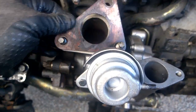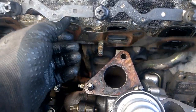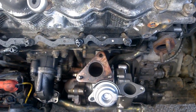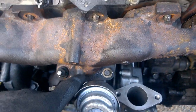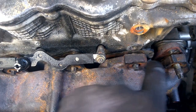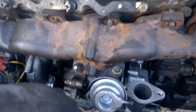Next, put on your washer — actually I meant gaskets — for the exhaust manifold. I left the nut there so it all hangs and doesn't fall on you. There's the manifold. You need a gasket here, a gasket there, and a gasket there, and then just bolt it all up together. That's the next step.